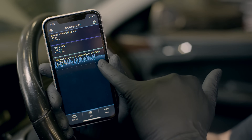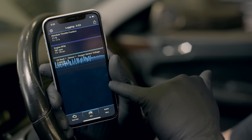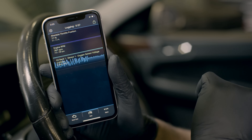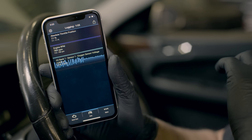We can see that the data changed as soon as Chris pulled the hose. What we're looking for is for the data to go low and read a low voltage. In our case it's not doing that, so this sensor might be bad. While we're showing this test on sensor 1, the pre-cat sensor, this test could also be applied to sensor 2, the post-cat sensor.